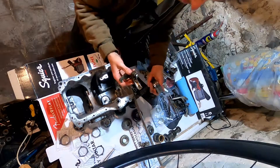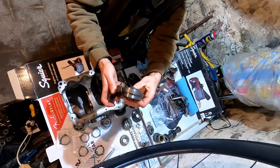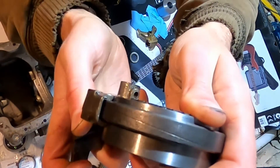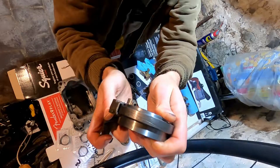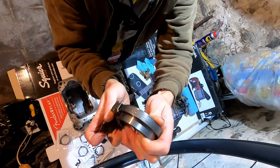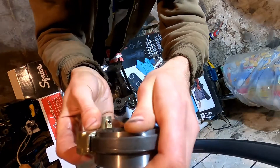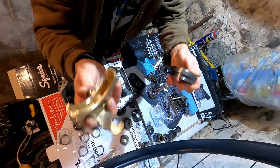So this is a selector fork and the synchro hub. The selector fork shifts things from side to side to change gear. However, you can see there is a lot of wear on the inside of that fork, which translates into play. It's just not a nice feeling on the shifter because it travels a fair distance — this gets magnified, so it may only be one and a half to two millimetres of play, but it's quite a lot on the gear stick end. And comparing it to the new one, there's no movement whatsoever.